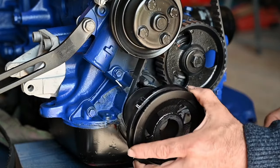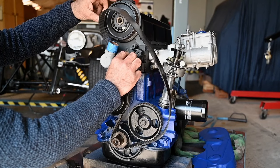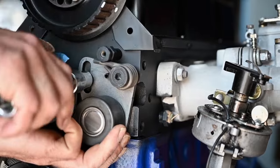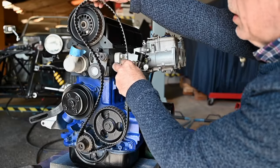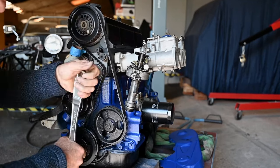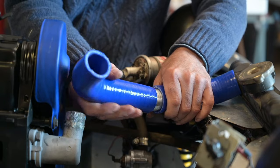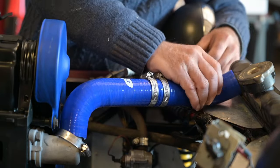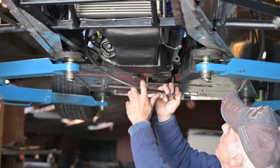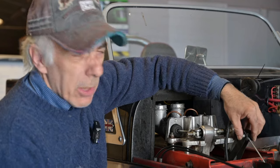Now it's time to take care of the timing belt as mentioned before. I had the engine repainted and now we're going to replace the belt and also the tensioner. The belt goes back on, and you may notice white spots on the camshaft and on the crankshaft — these are my reference marks so I know the timing will be correct. Old cars have old hoses, so I replaced most — actually almost all — of the hoses with silicone-based hoses.